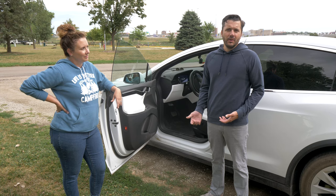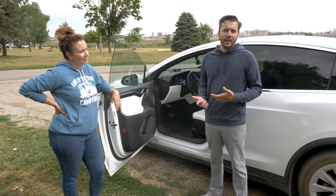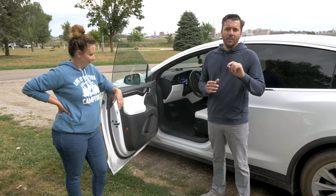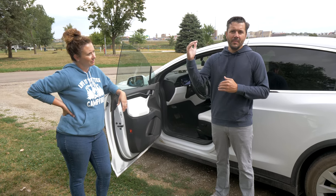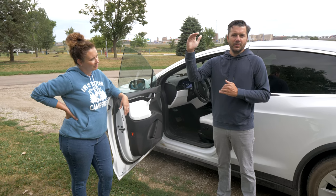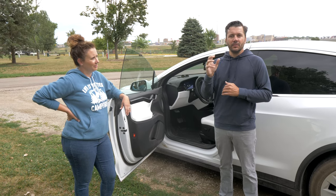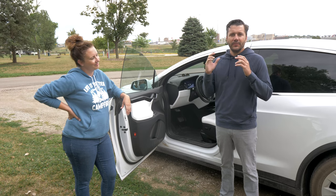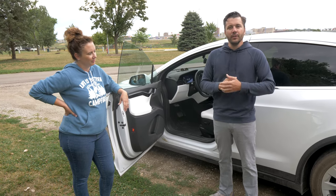On average, when we're pulling our trailer at 60 miles per hour, we're getting roughly about 800 watt-hours per mile. How I usually figure that out is about 1% of charge per mile. So when we're planning a charge stop, if we have to go 73 miles, I'll try to charge up to about 78% to give us a little leeway. Sometimes you can bump your speed up a little if you get the wind behind you, and sometimes you have to slow down if the wind's coming at you from a bad angle — that's how we figure out how much range we need with this trailer.